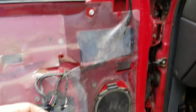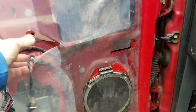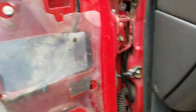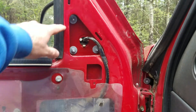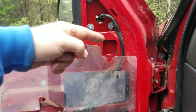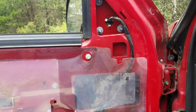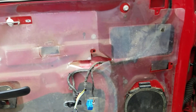Now that I've got the door panel off, you can see here's the wire — it comes around like I was telling you, and it's right here. There are a couple of those little clips that hold the wire in the door. The new mirrors do a good job about having those little clips in there too. I'm going to go ahead and take these three 10-millimeter nuts off, swap the mirror out, and then the installation is pretty much the reverse. Just get your mirror bolted in, snake your wires around to where they need to go, tilt the panel up the way I showed you, unplug the wires, twist it back down, don't forget to plug in that fellow down there. Then you just put it back together, and that's the end of it.